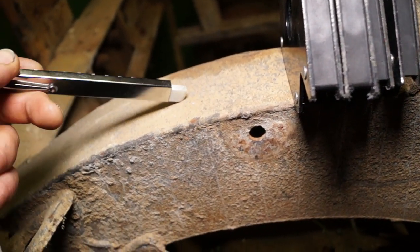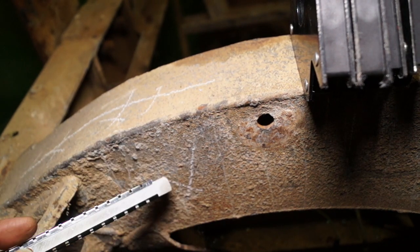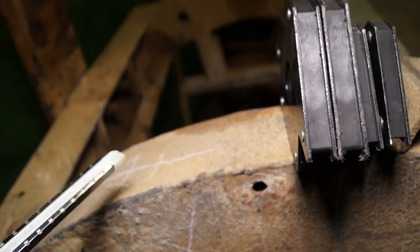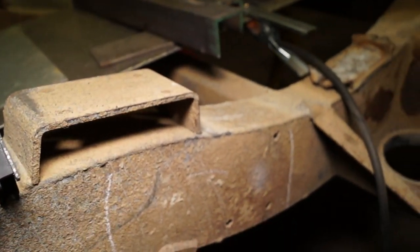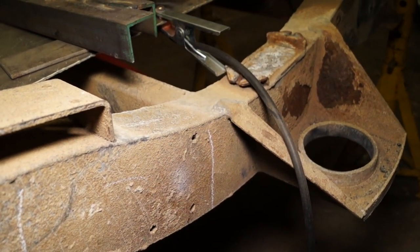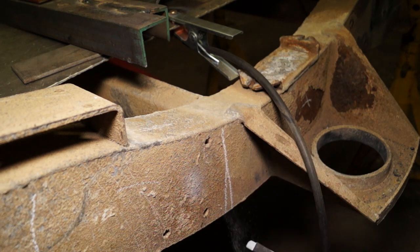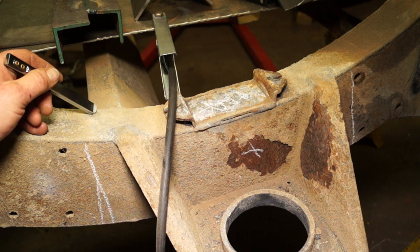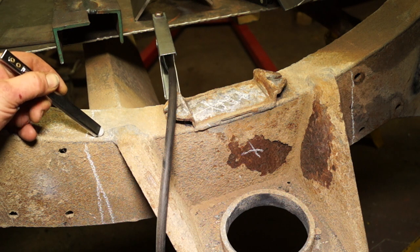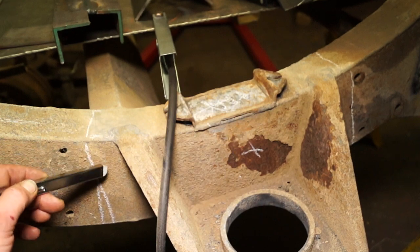On to our Defender and Discovery chassis. This area especially on Defenders and Discoveries tends to rot out — mainly on the 110s — on the outside and on the inside of the chassis rails. What I have here is the top mount of the spring and it's rotten, so I'm going to make a cut here and here, remove a portion of the chassis rail along with this section, which will give you a practical insight into how to do most chassis rails.